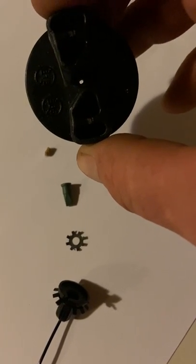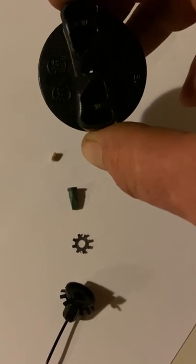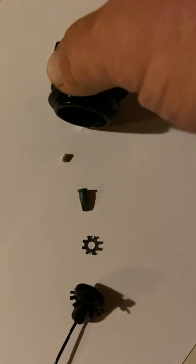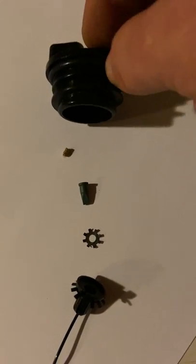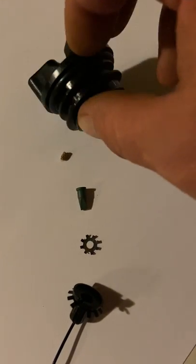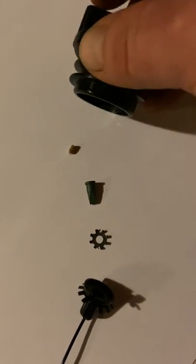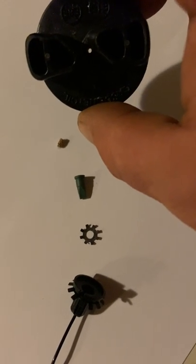Mine had sawdust all over it, so I thought maybe that's the problem and it wasn't venting properly. I started cleaning it — shot carb cleaner in there, tried shooting air through it, put it up to my mouth, blew through it. I tried from one direction, which of course it won't go because the duck bill won't let the fuel out or the air, but I tried to blow it from that direction and couldn't get anything through it.